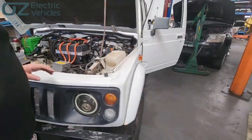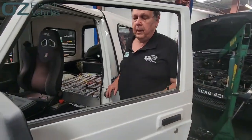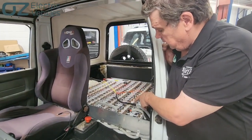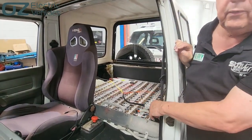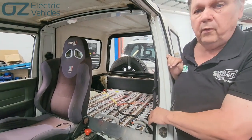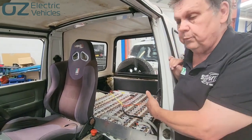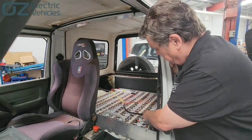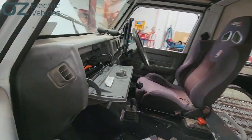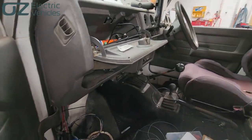Moving right around here, we'll show you what we've done. He actually made up his own battery pack. We supplied the battery cells and the battery retainers — these are little plastic retainers that hold each battery separated from the battery next to it, keeps it nice and tight in there. Just some threaded rods go through there through the whole length to hold it all together. So he's put the battery pack in, we've wired up the battery management system to itself, and that goes through to a battery management box which is hidden under the dash. In turn that works the fuel gauge and gives you the capacity of the battery at any time.